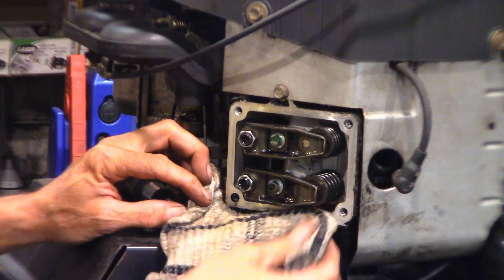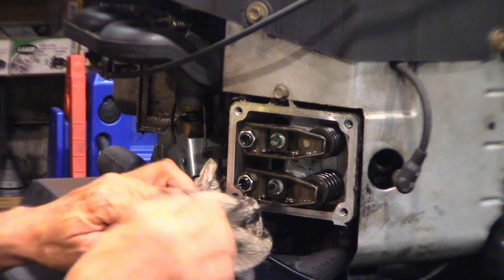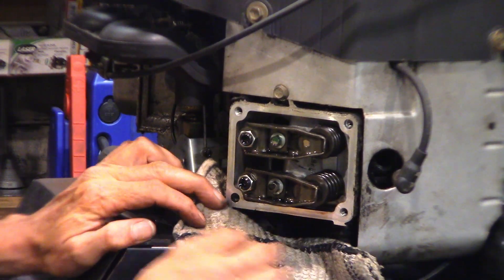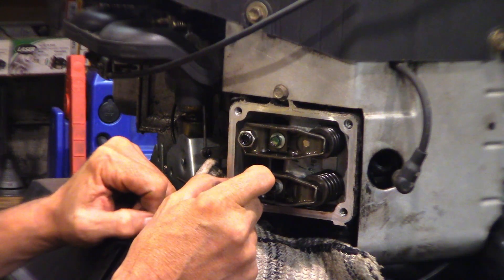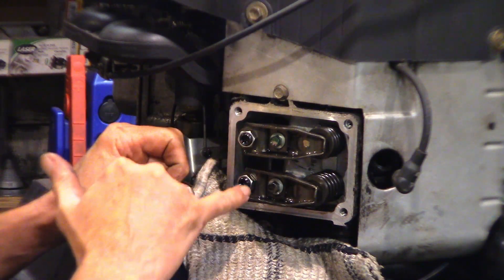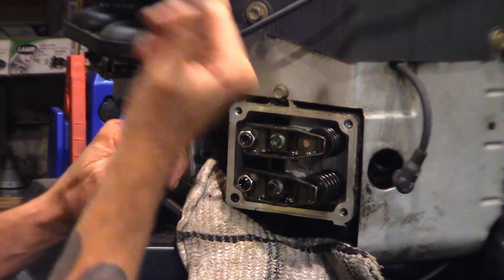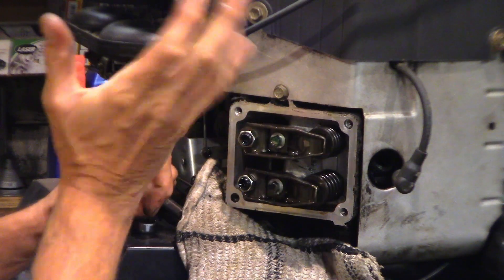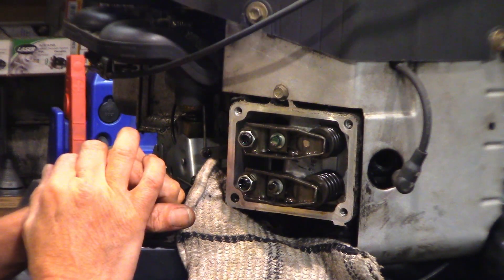This one was a T40 and a half-inch or 13 millimeter nut. The other style uses a T20 in the center and I think it's the same half-inch or 13 millimeter nut on the outside — just a different style of adjuster, but the idea is the same.